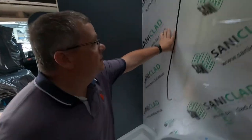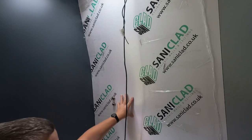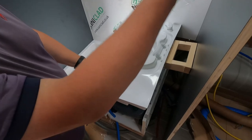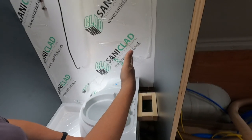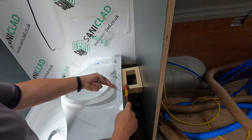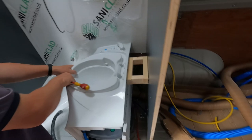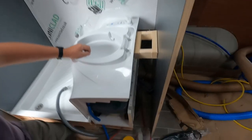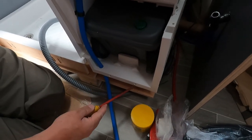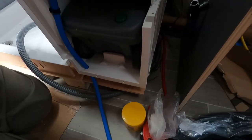The cladding is on - the Sikaflex has done the job, it's nice and solid and not coming off in a hurry. The toilet is put into position and behind it, because the sink unit is going to come up here with a flip-down top, I've secured the toilet with a wooden brace - four screws through there fixed from the other side, so it's nice and solid and isn't going to go anywhere. I might put another piece of wood at the bottom too - there are some screw holes there so I can screw down to stop any sideways movement when getting the cassette in and out.